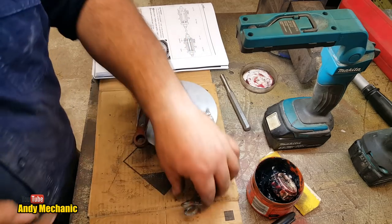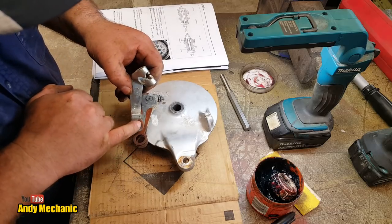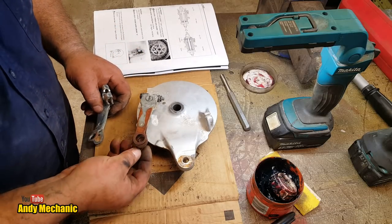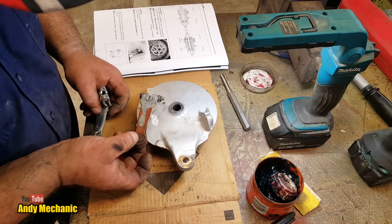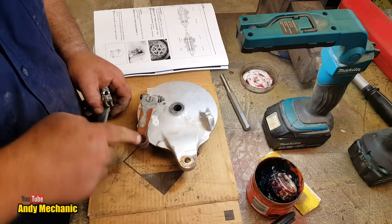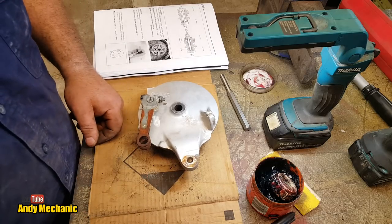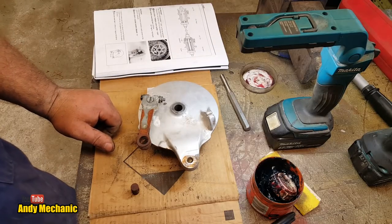There we go. One thing I have spotted. Quite a bit of wear on there. Can you see the difference in the thickness? That's about half the thickness of what's there. So the little barrel that sits in there on the donor bike is loose. You see the movement on there, look? It's not the end of the world, but imagine if that was to tear open whilst you're panicking and pressing the brake and that goes clink and pulls out. No rear brake. But I think it'd be fine for what we want. It's not going to get much use from now on.